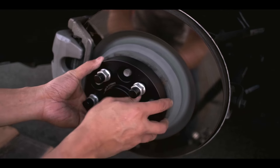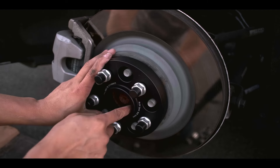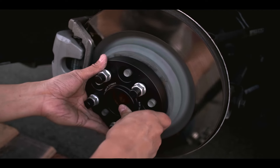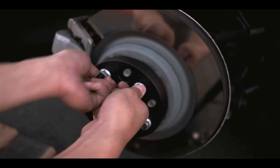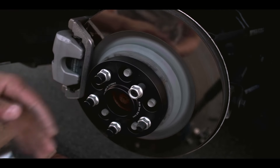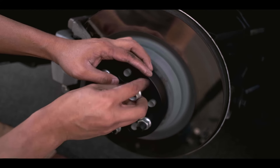For the back we're going to put the 25mm and see how it fits. This one has the same wheel hub ring — center hub, centric, whatever. I forgot the spec but I'll leave it below; it's like 56-point-something. We got these little covers to take off. I do know that these are different sizes — for the wheel, the lug nuts are 21mm, and for the spacer these are 19mm, so they go in here.